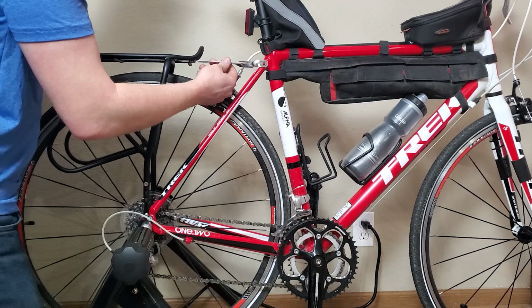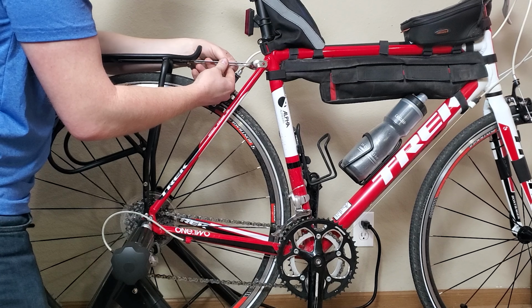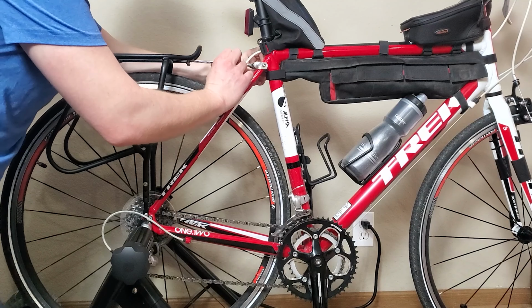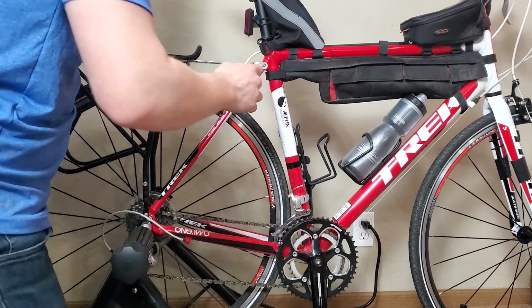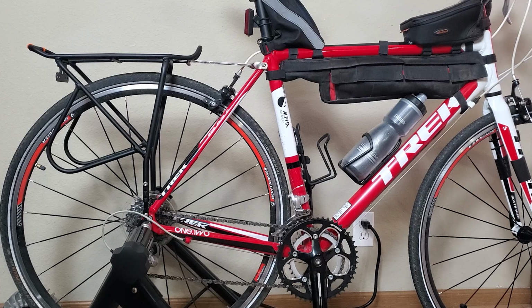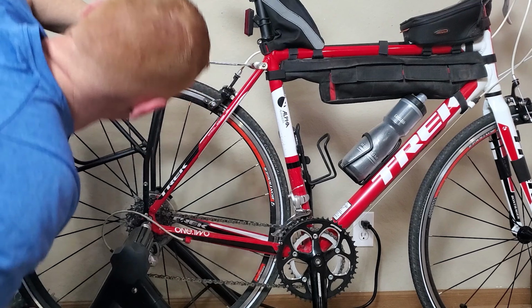With this temporarily installed, it allows me to move these easily, and you see it goes directly to my seat tube mounts. Now in some of these bars, you will have to bend and manipulate the support rods. I had to on Christina's road bike so that everything fits and nothing clinks against the brake, because that's what I'm worried about the most. Which in this case, it doesn't. And for this bike, that's about as level as that's going to get. Then I'll install the remaining 2 screws.